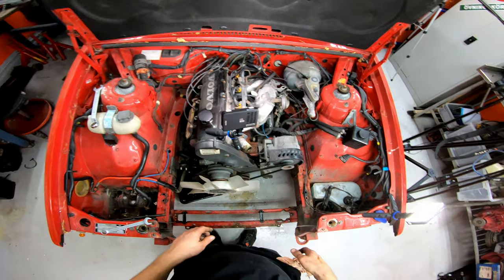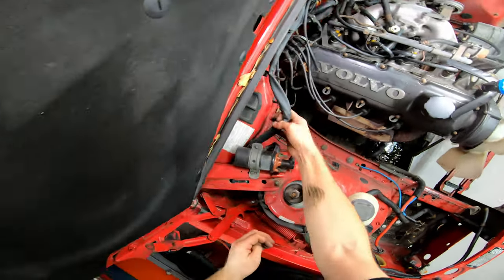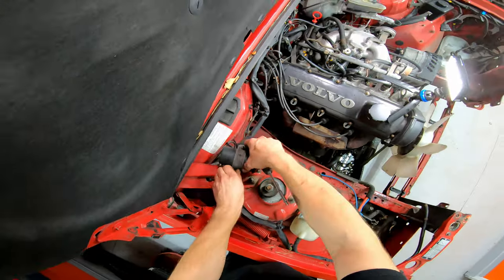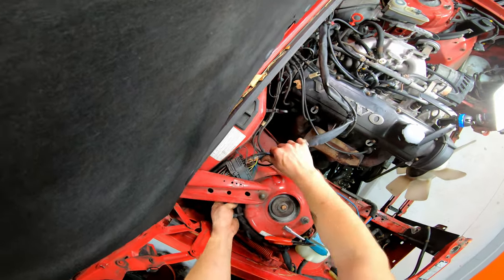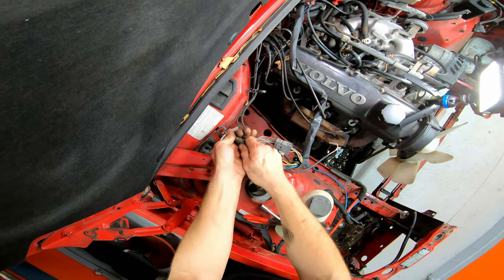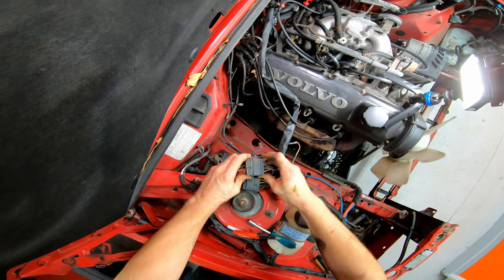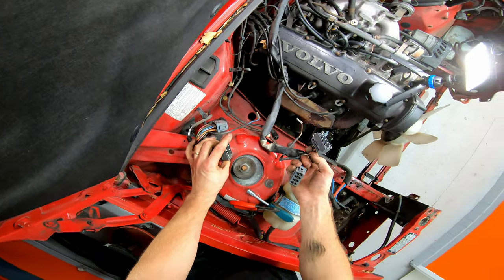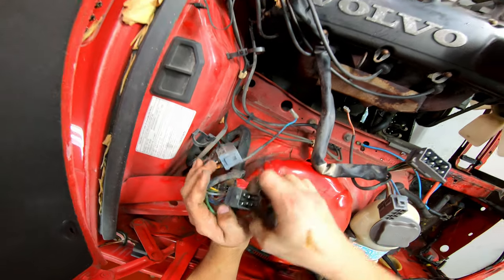Next up, I'm thinking wires. Let's start with the main wiring loom, as I like to call it. Let's get this off — we're not going to be using this anymore. So then we move over here, cut this off, and we have the connectors right here going into the car. We have the lambda right here, or the oxygen sensor. If you have weird engine trouble, this is a good place to look — it's kind of oxidized.